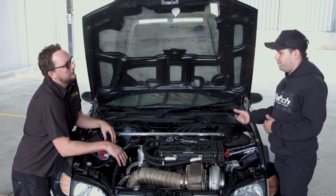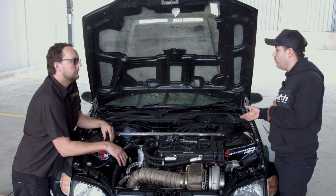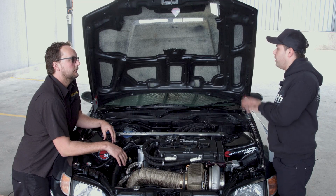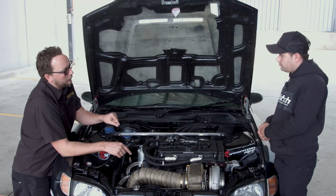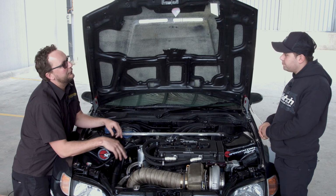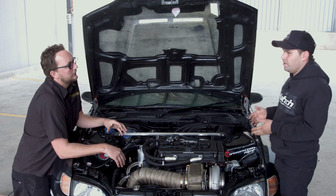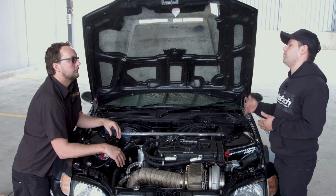Basically, instead of a valve flicking on and switching the cam over to a different lobe, we've blocked that all off, so it's consistently on a 2-lobe cam at the moment. Right, so because this has got an oil pressure sensor in it, when it was flicking over to the second set of VTEC lobes, could you actually see a difference in the oil pressure in the logs? Yes, you could see about a 10 psi to 15 psi drop as VTEC would come on.